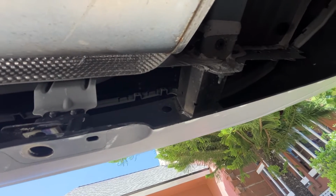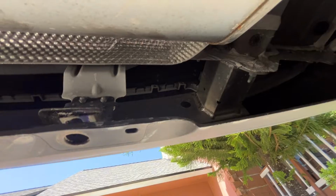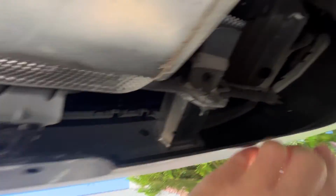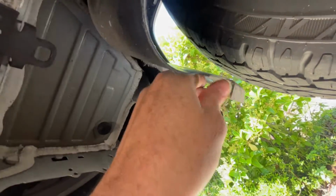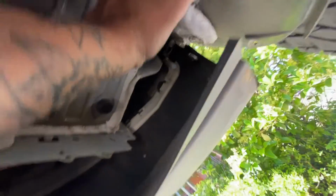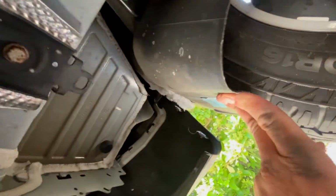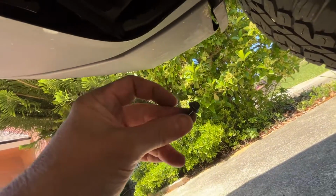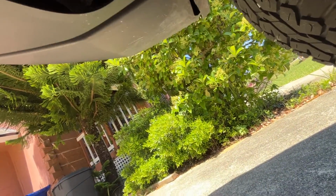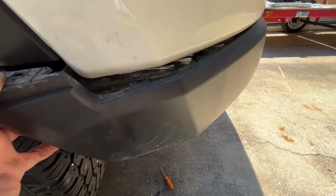All right, so correction with the 3 bolts. They were talking about 3 bolts. They weren't including the 2 lower fascia ones. Once you got the wheel liner removed, it's those 2, and there's another one tucked right up there. There's another 8mm. All right, another correction. That's actually a 7mm up there. So you got the 7mm with the small washer up in the corner, and these 8mm with the large washer are where the mud flaps go.